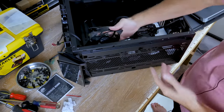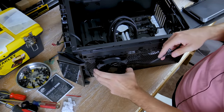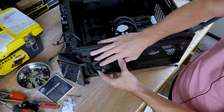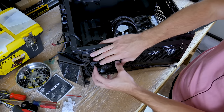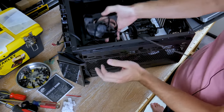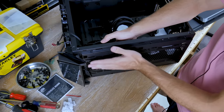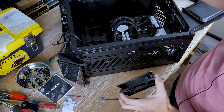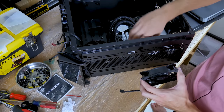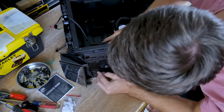I'm mounting the AIO on the inside of the top frame rather than the outside, because the top panel ventilation comes in from the sides — there would be less volume able to be expelled hitting the top and pushing out the sides. Being mounted here allows it to expel more air and not be as limited by the top panel. I would opt for a taller case to have better mounting clearance on top, since it is pretty narrow between the top frame and the motherboard.